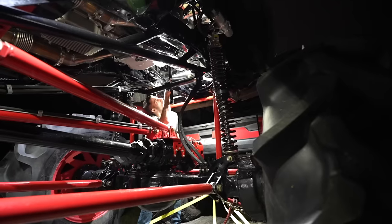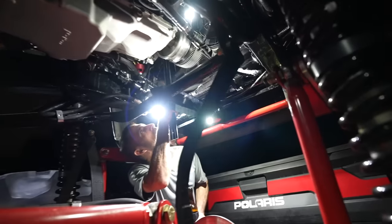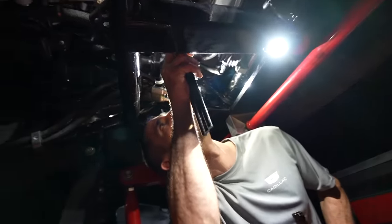That's Brian's mega truck that we're taking to the barn this weekend. He's having an issue with his serpentine belt shredding, so they're trying to identify which pulley is the problem. He's going to get a laser tool on it tomorrow, but right now he's trying to hit it with a straight edge. The alternator is definitely off — I think that's the only thing really far off.